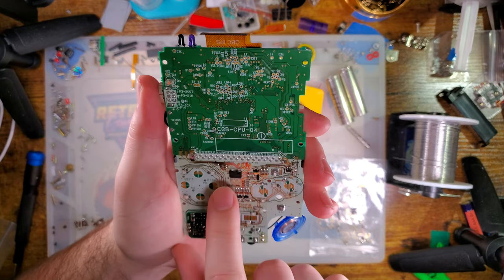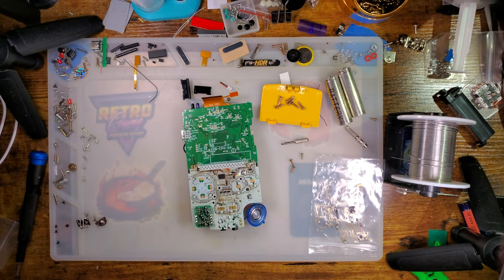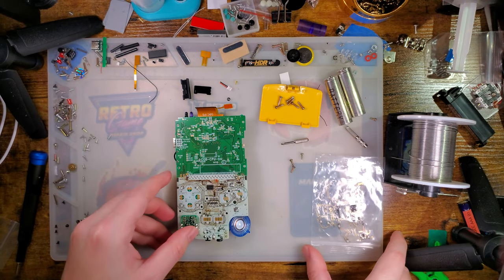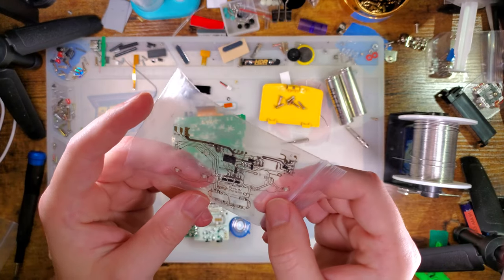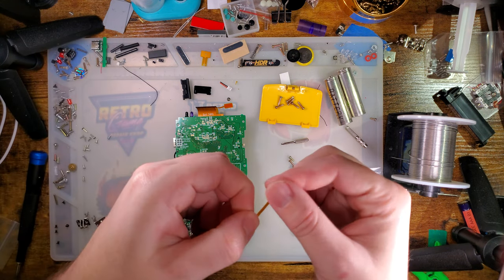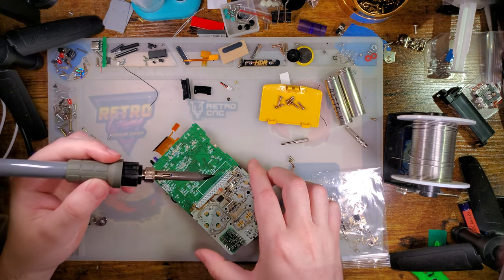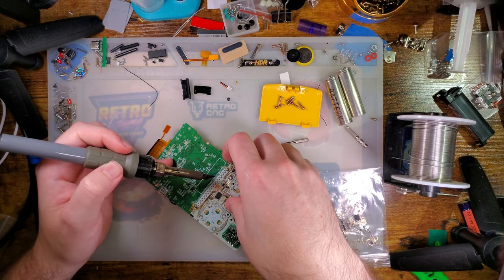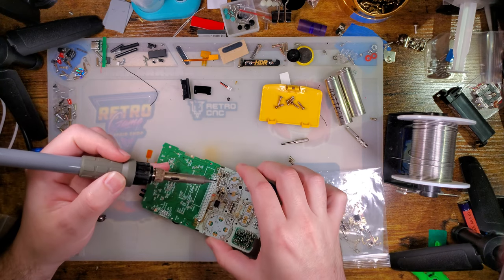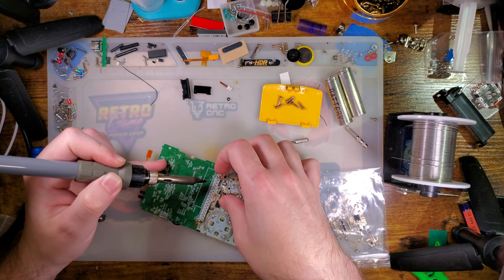All right, so as you can see, I've already got the clear button board in here. I went ahead and installed this one the first time around because I kind of wanted to use it as practice, because I'd never soldered with a board like this, and FunnyPlaying does specify that these require very low temperatures to solder, otherwise you will melt the substrate, because these aren't polyimide like the normal flex boards are. I'm not sure what specific material they are. They might just be PET, which makes sense that they'd melt at the temperatures that you're soldering at. They recommend below 200 degrees. I was able to get this in no problem soldering at about 300 degrees Celsius, but I was also in and out real quick. I don't expect to get as lucky desoldering this thing.